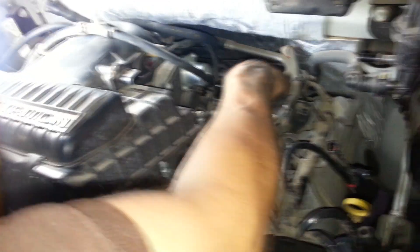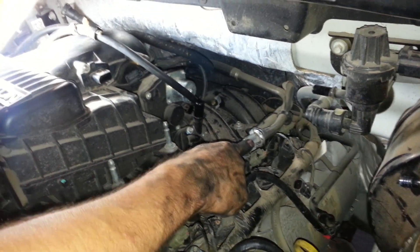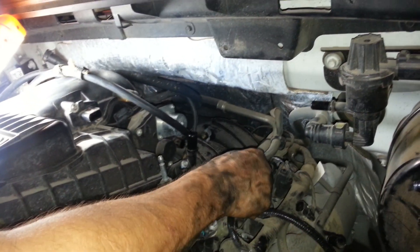As you can see, look at all the space that's available to you right now. So when you loosen these screws right here, you've got room, and this fuel rail is just going to come up this way after you disconnect your main gas line right here. To disconnect your main gas line, you need those special tools that connect in the back to loosen your rail, just like the ones you use for your AC.